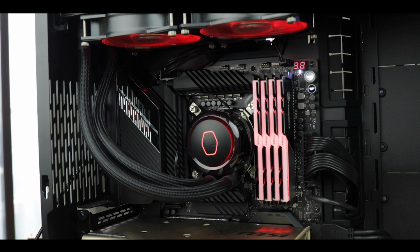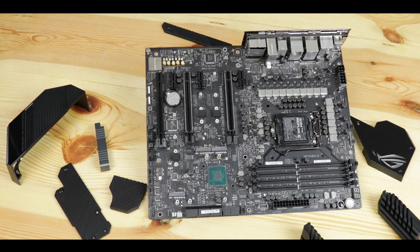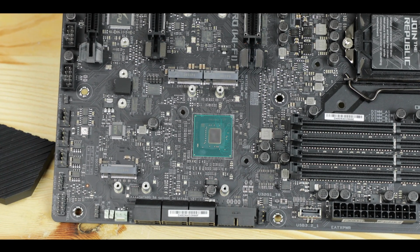If you are already rocking and operating a Z390/9th generation Intel processor, is it worth upgrading motherboard and processor? And the short answer is, right now, no. Despite being a beautiful board, it remains a PCIe 3.0 standard board, and it will not change until a September release of the 11th generation of Intel Core processors, which will enable double the bandwidth at PCIe 4.0 level. So until then, I can see a reasonable argument for staying with your Z390/9th generation Intel Core processor, at least for now.